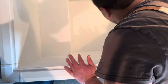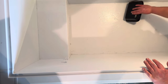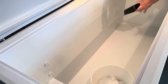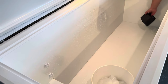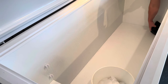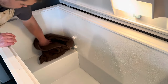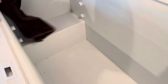Now you can see clearly one of the cons of a chest freezer — you need to be fairly tall and able-bodied to get to the things in the very bottom. However, there are a lot of pros that come with a chest freezer, and they are my preferred type. I just think they perform better than uprights. Chest freezers also have more usable space inside compared to an upright, and they are typically less expensive to buy and less expensive to run. Because of the way everything packs snugly into a chest freezer, food will last longer if the power goes out than it will in an upright, usually by a whole day. Two other cons are that they take up more floor space than an upright, and they usually only come in this very utilitarian white color.